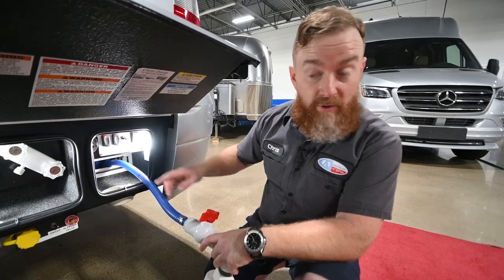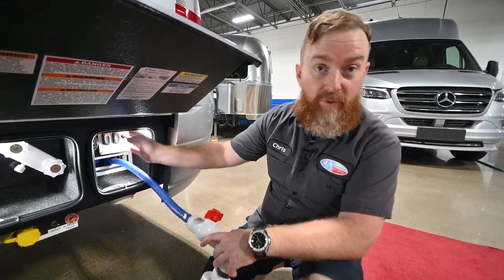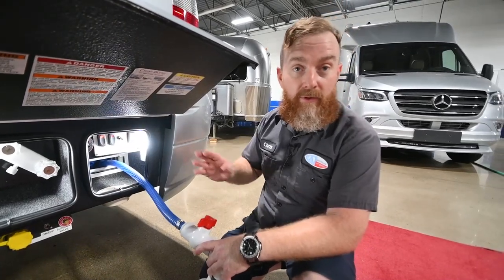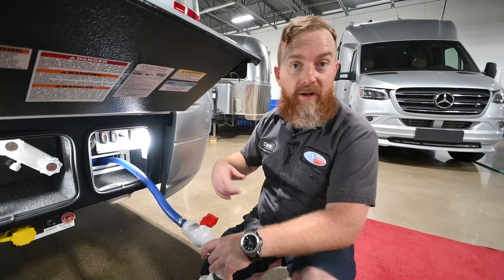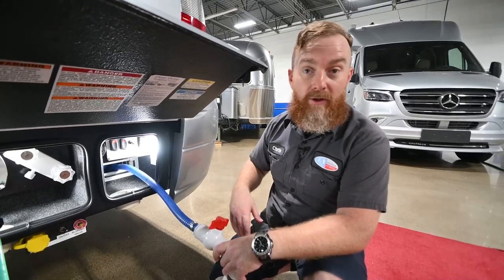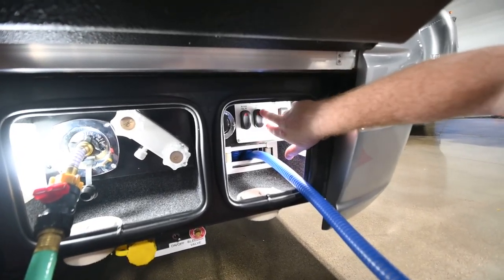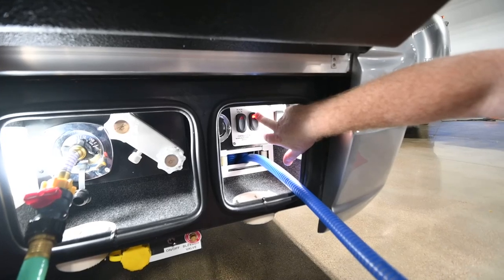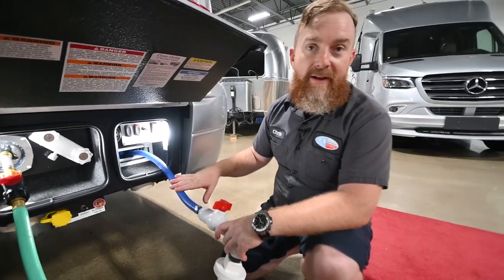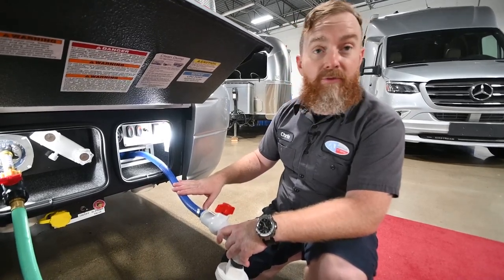You've got your fresh water coming in your waste port, so when you see the flow in the translucent hose go from muddy to clear, turn the water off with the pump still running. When the pitch on the pump changes from low to high pitch, turn the pump off. That'll leave a little water in the black tank so you can add a chemical in there — it'll dissolve and slosh around as you're driving, helping keep your waste tank cleaner. Close the black tank valve, then open the gray tank valve, turn the pump back on, and on this tank just pump the water straight out. The gray tank has mostly soapy water from your sinks and showers — do that one second so it helps wash the pipe out, but you don't need to flush that one out.